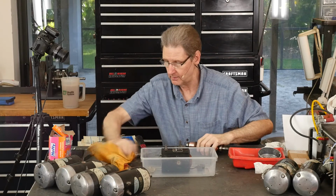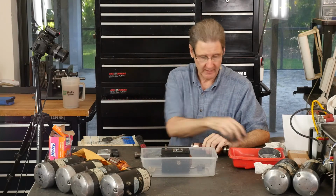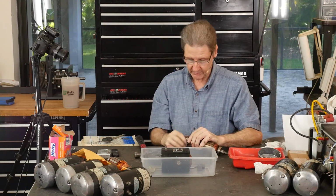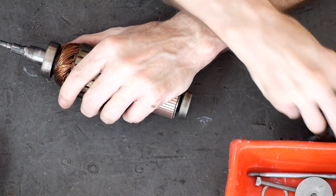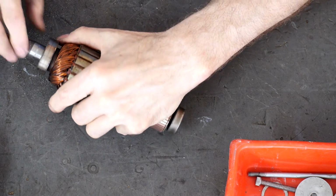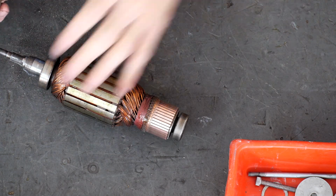This one actually has a little more drag because it's lubricated. You can't buy a needle here because Puritan values. You should have a little grease and a needle, and you get under this seal and stick a little grease in, you could relubricate these bearings, but we're going to have to live without it. Examine the seal surface. Oh, it's got a little groove there. Let's use our steel wool, see if we can't clean this up too. And that's the trick: you can always pound in the seal a little more or a little less to try to avoid this little wear groove here. But that's that.